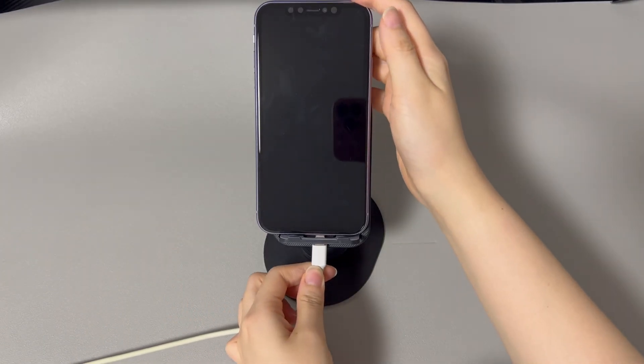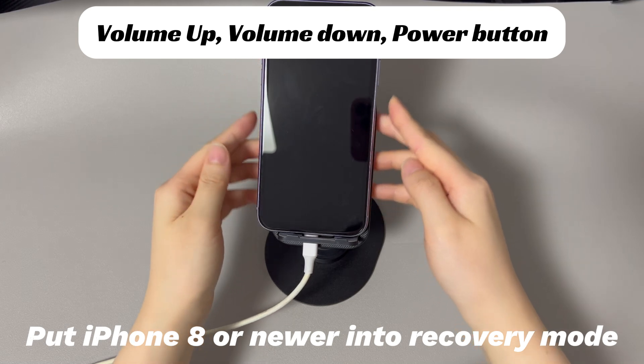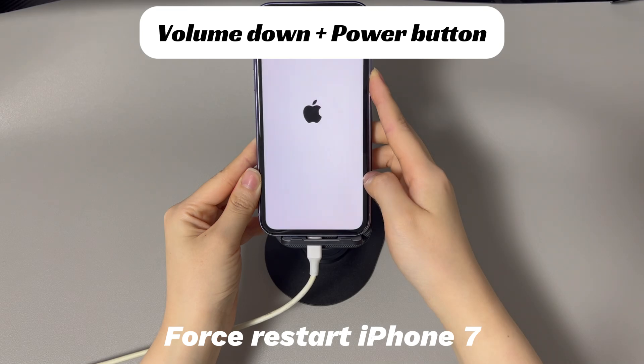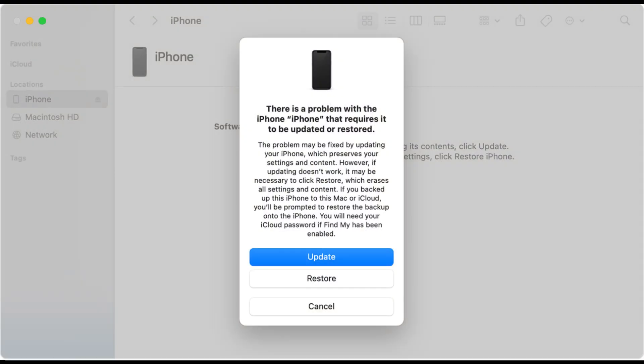After you decide to do this, follow these steps. Let your iPhone be plugged into the computer running iTunes or Finder. Enter recovery mode: for iPhone 8 and later, press and quickly release volume up, then volume down, then hold the side button until the recovery mode screen appears. For iPhone 7 and 7 Plus, press and hold the volume down and side button simultaneously. For iPhone 6s and earlier, press and hold the home and side/top button simultaneously. Then in iTunes or Finder, choose Restore in the dialog box and follow the on-screen instructions. When the progress bar completes, the restore is done. If your iPhone turns on and vibrates, your issue is fixed — just set up your phone as prompted.